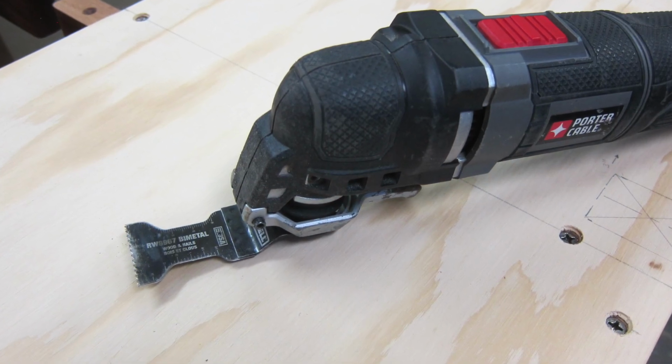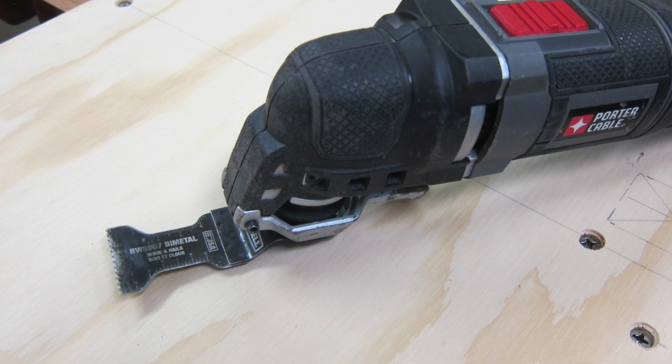So to join them together, I used thickened epoxy, really cleaned it well with acetone. I actually took my oscillating tool with a saw blade on it and kind of roughened up the edge surfaces just to give something more for the epoxy to bite into. Wasn't really sure how epoxy and EPE kind of mixed together, even though I used it on the rub rails, but I still was a little leery about it. So I followed more of what you would do for attaching teak, which is cleaning with acetone and all this business. So anyways, I did that method.